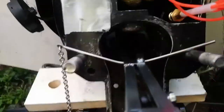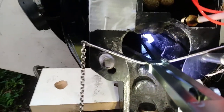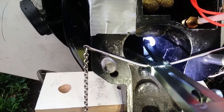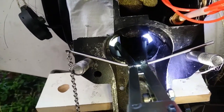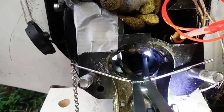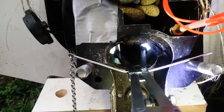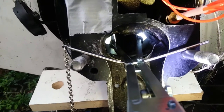I had to take the shift shaft out of the bell housing — I just think that was the easiest way to do that. The bolt that holds the shift arm onto the shift shaft was seized, so I just took the whole bar out, cut the bar out, and put a new bar in there — a new shaft and a new arm. But getting this bellow on there is pretty easy with the bellow tool.